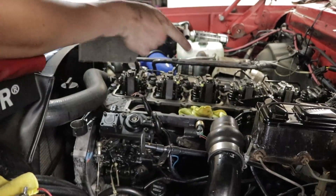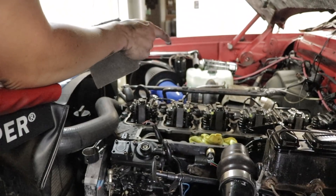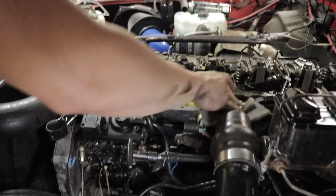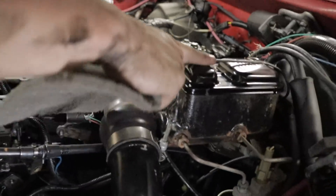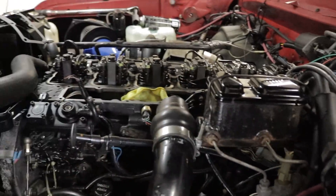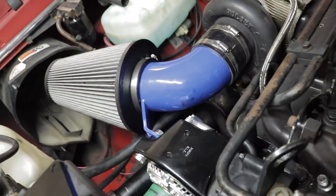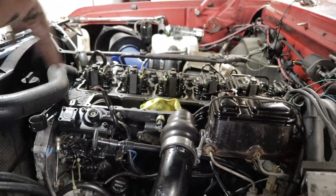Just a little update — we're test-fitting the fuel lines now. We've got the longer ones on here, the ones that go to the fourth, fifth, and sixth cylinder. We've got a few injectors in right now. I've got them all cleaned out. We're about to throw two more injectors in there. Right now I'm just scoring up using a Scotch-Brite scuff pad, just getting it ready for the new gasket. We've got a lot of progress done guys. We've got our powder-coated master cylinder cover. We've also got our new powder-coated alternator bracket — we've got that in there. Everything needs to be cleaned — everything you see has smudges of just grease and oil, so nothing is what it's going to look like when it's all done. Just keep that in mind before you comment.